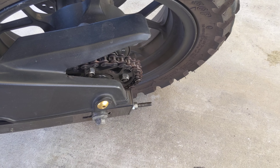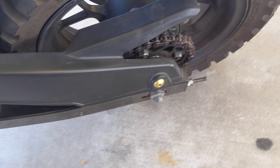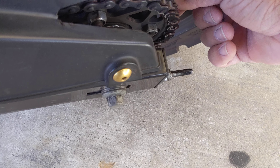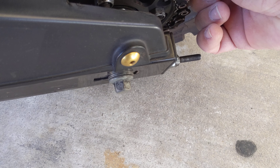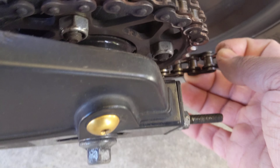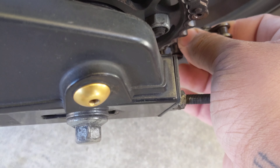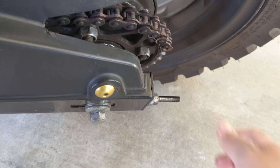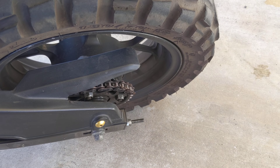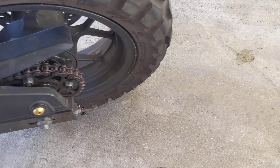This is an O-ring chain — this is a DID chain that does have the O-rings on it. I did not get a replacement O-ring chain, though I probably should. I'll be getting that on the next chain replacement. As you can see, that's not really movable — it barely even moves. I had issues with it not catching, pretty much it would slip. So I knew it was about time anyway.